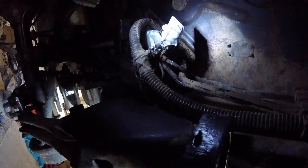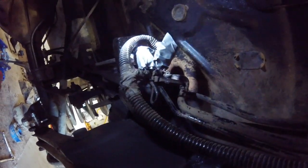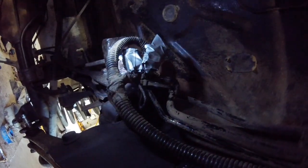I taped over where the two ABS lines came in. The one with the longer, skinnier wire is for the driver's side ABS, just in case I try to re-hook this up later — the other one is the passenger side. I'm getting all the cables out and saving it all. It seems pretty hard to find new axle shafts with a tone ring, and I didn't want to press one on, but I want to keep everything just in case. ABS is always a good thing to have.